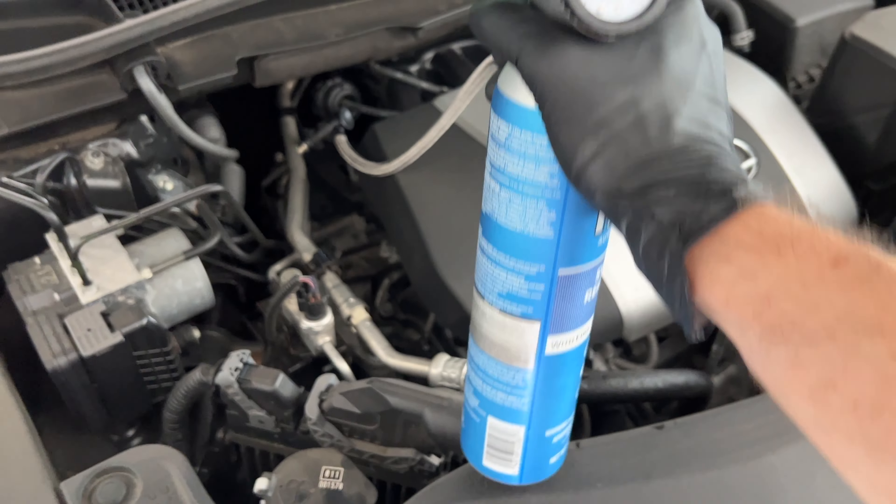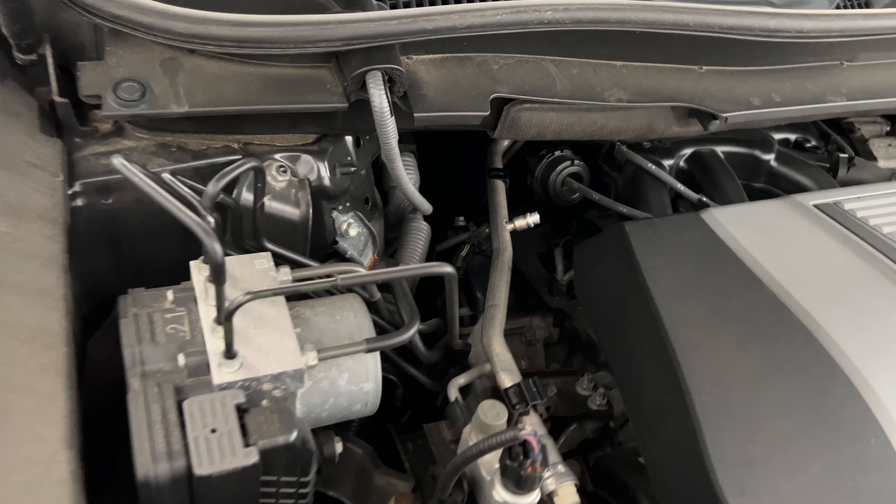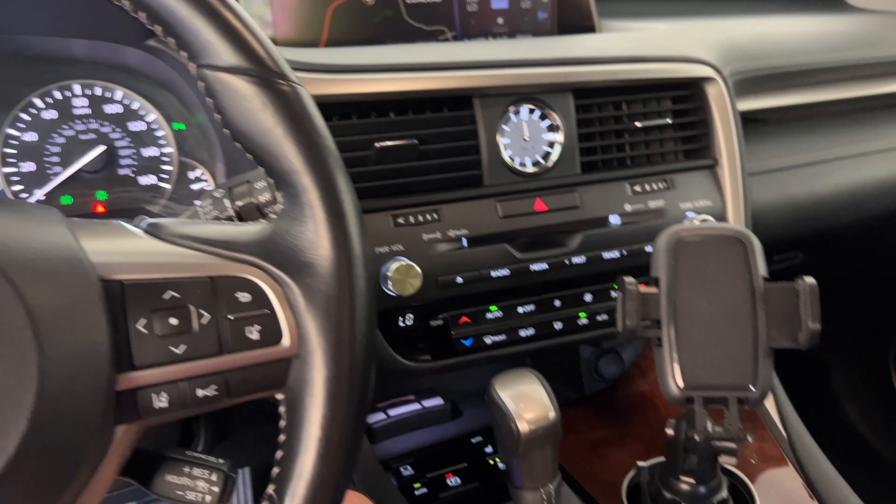The needle moved up a little bit. Oh yeah, it's freezing cold in here now. I didn't even realize it was not blowing cold, but I guess they test the pressure to see if it has enough — they said it was right on the border of being low and filled. I went through the last 20% of those two cans and it definitely took some. You don't need to be all the way up into the green; just touching the green is fine, because you don't want to risk putting too much in or creating high pressures. If it's in the green, you're good. If it's on the border of green, put some in. It took some, and I've got another brand new can for the future. Hope this video helped — until next time.